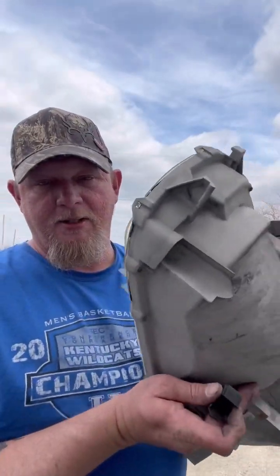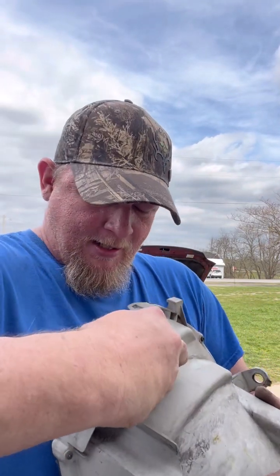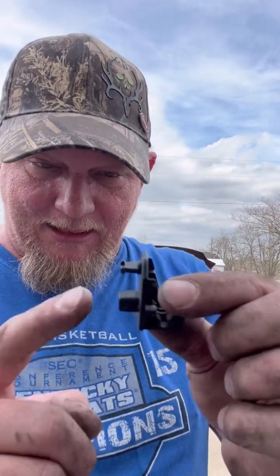Back for a minute because I just had something happen and I want to make sure I address it. This is that little clip at the headlight housing — it actually slides in and locks. That's what you have to rock to get it back out. When I was putting the other headlight back in, my hand knocked this and it fell out. It's a little square with a little pin — pops and locks in place. If you try to put your headlight in and it's moving on the bottom, you probably knocked it down. Look down at the bumper cover, find it, put it back in place, lock it in.